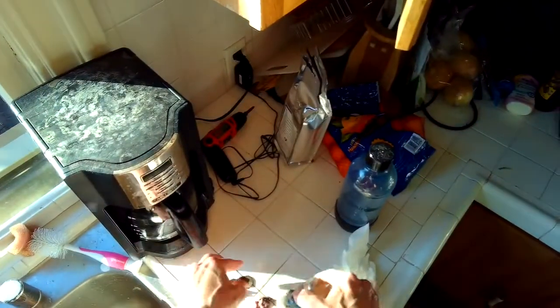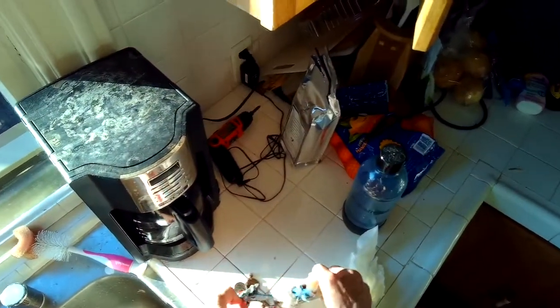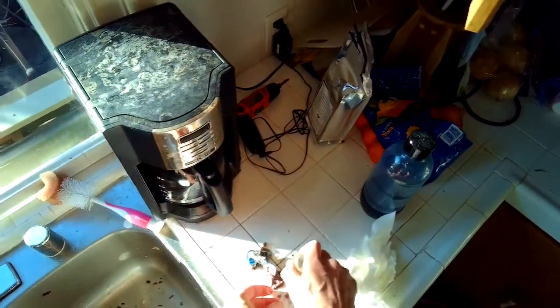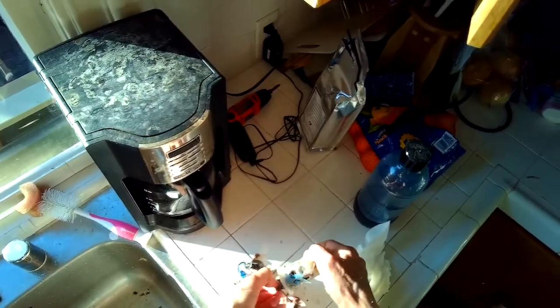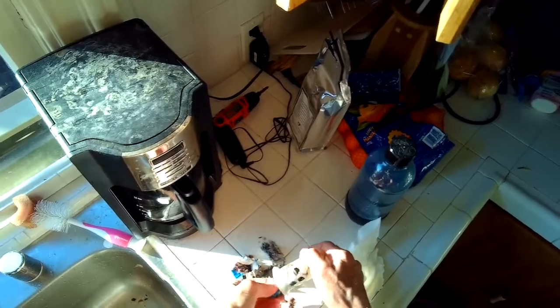And then once you get it back, you can find some stuff's caught in there, and you can pull out this plastic thing that grabs a hold of coins. Anytime I move an appliance, debris. This is probably about 10 years worth of stuff got collected in here. So I'm going to empty it out. Wow. And then I'll just rinse it and wash it, and then I'll install it back in the washing machine.